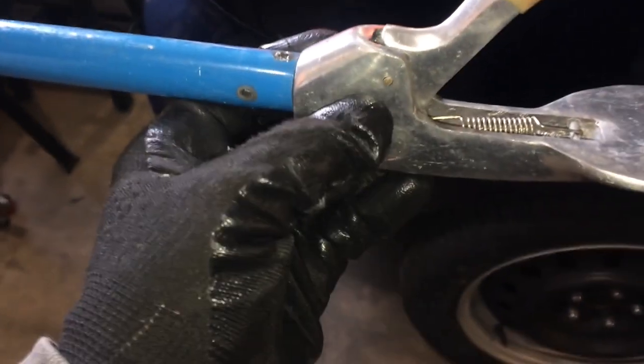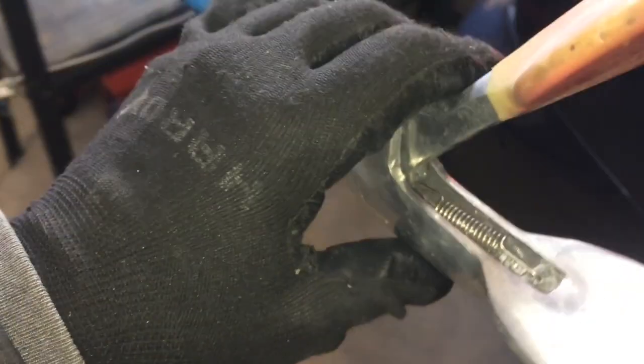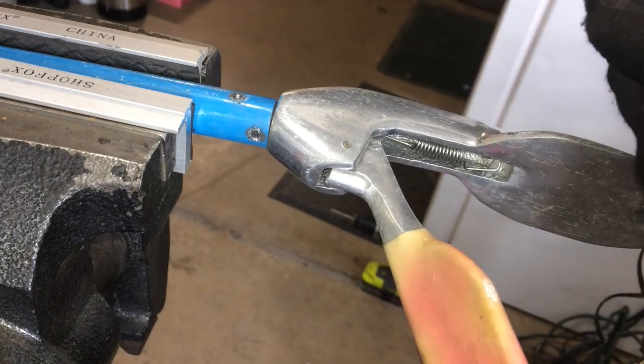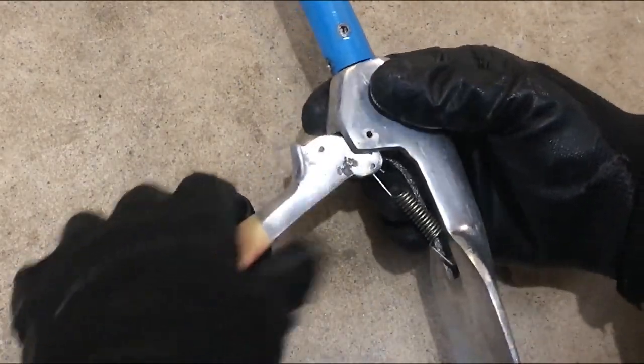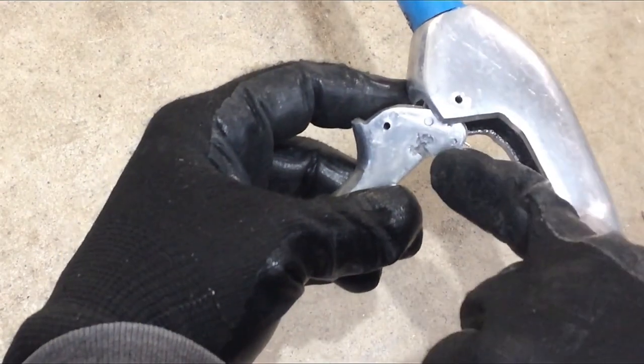On the other side the pins are smaller — there's the pin and the cable is looped in under there. I'm going to work on this side. I'll use my rotary tool to grind that down ever so slightly so I can tap that pin out. With that pin out, I can pull it down. I've got another pin here, and that's where the cable loop is. I'll do the same thing on this pin and take that spring out of the way.